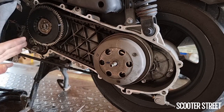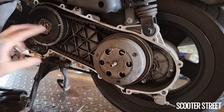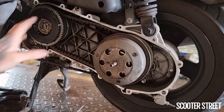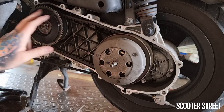This is another really good reason why you should regularly check your transmission — usually every 3,000 kilometres. If you have performance parts on your scooter, it's often worth doing it every 1,500 to 2,000 kilometres, because you're putting the parts under more load and strain. I've also seen advice going around saying you should just remove the plastic fan — this is the worst thing you can possibly do. Take your bike for a five-minute ride, pull the transmission cover off, and feel how hot that variator gets — it gets extremely hot. In the case I mentioned where the fan blew apart and the bike continued to ride, the rollers and guides actually melted. That's how much of a difference this fan makes — you must have the fan. You cannot run without it. You will melt your transmission.